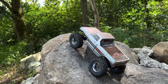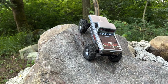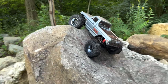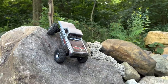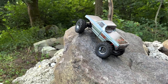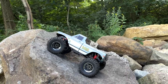Okay, so it's still dropping out on that particular angle right there. It's not surprising. It gets pretty vertical. Before, it would not crest the front tires on this particular line. It's not a problem there. It doesn't have the breakover angle to pull that right there, though. I mean, I could bump it, but just the fact that it was staying stable going up that line, that's definitely a huge improvement. And not rolling over right there. Things steady as a rock. Not bad.